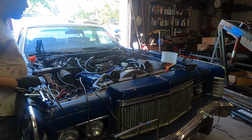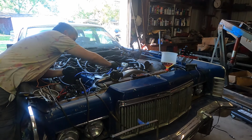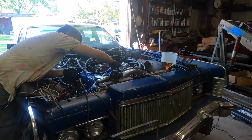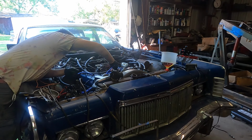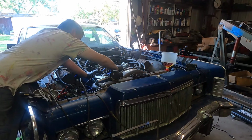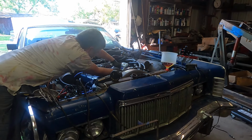Yeah. So we're going to speed this part of the video up a little bit and I'll do some voiceover. Realized as I'm editing this that the shop fans destroyed the audio quality of my voice. They were so loud. So I apologize for that. But when we were cranking it over, it was popping back through the carburetor. I had already checked the timing with the light, and so we knew it was not just slightly off, where we just needed to advance or retard the distributor. It had to be way off. So I came to the conclusion it's got to be 180 degrees off.